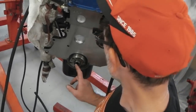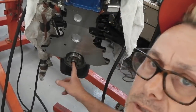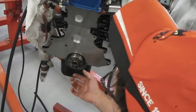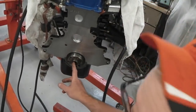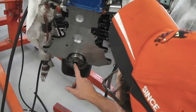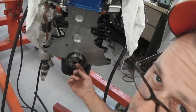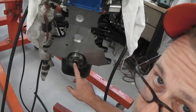So I'm going to put some grease into this now. This spigot bearing is for the end of the clutch, slots in, centres everything. But you don't need it on an automatic gearbox. And indeed, you've got to take it out because the nib of the torque converter goes into here, so we've got to get this out anyway. Now they're pushed in, but what you do is pack grease into it and get a dowel and whack the dowel, the grease comes back on itself and the idea is you hydraulic it out. So we'll get on and do that now.